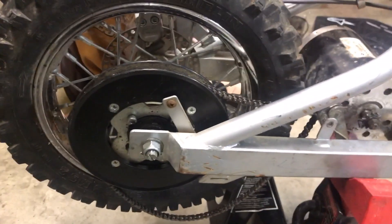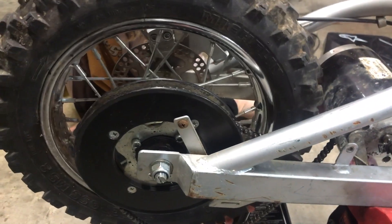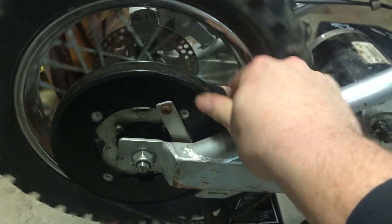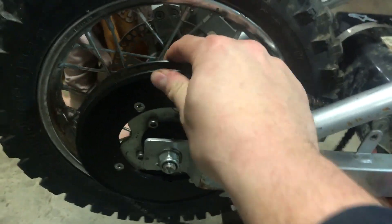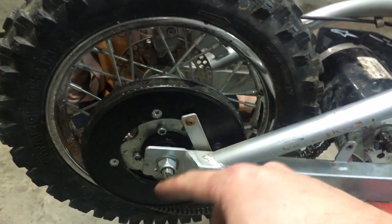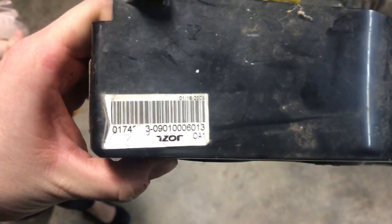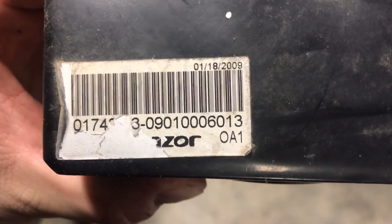Back here is another common area of failure. This is called a Sprague one-way clutch, or freewheel — it's essentially a one-way bearing. Once power stops from the motor, it can keep spinning without this part moving, just like a bicycle. The problem is this one locks up sometimes both ways and sounds awful when rolling. We're going to replace the freewheel. Looking at the date code on the cover, this bike was made 11 years ago — this thing's old.